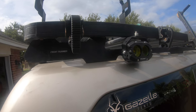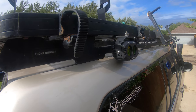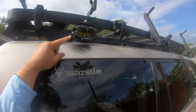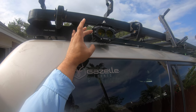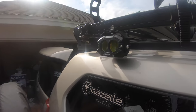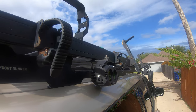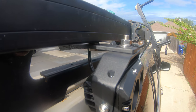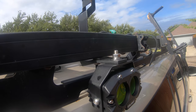I already installed the lights. Because of the way I had the roof rack set up — designed around my other accessories — I never thought about lighting. So I had to modify some of the brackets where the lights are attached. This one needed a little extra space, so I found some old brackets I had laying around, made some modifications, cut it up a little bit, measured it, and made sure it wasn't going to interfere with the shovel. It fit perfectly.